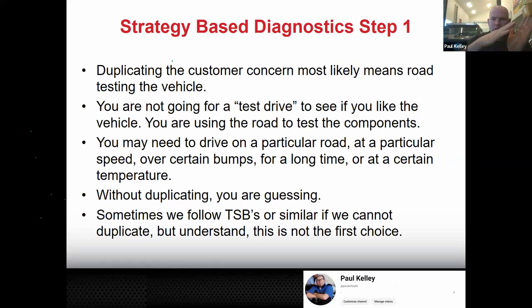Then when she'd do the other turn, it'd flop like this because the wheel bearing was loose and push the lower piston and then the upper piston and then the lower piston. By the time she went through three or four aisles, the piston was pushed back in and there was a big gap between the rotor and the brake pad. So the first time she hit the brakes, all that brake pedal movement would go to taking up the gap, and it wouldn't build pressure. So the first brake application would go to the floor.